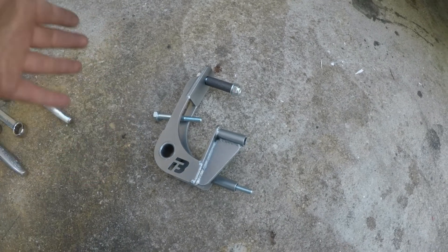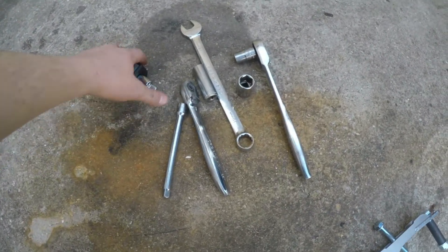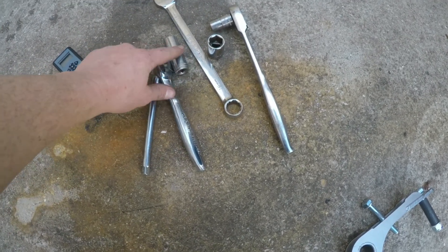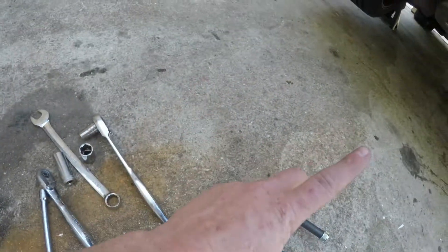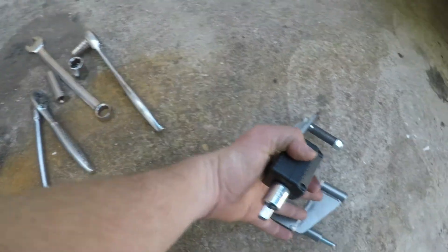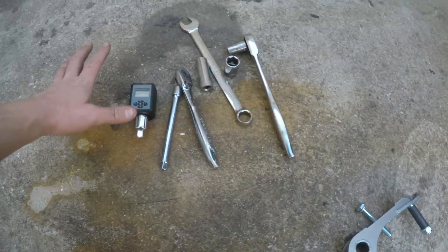So today we're going to go ahead and install this — it's going to be super easy. Everything you need is right here. You need two 19mm sockets, preferably a socket and a wrench, a 17 millimeter, and a 14 millimeter. The 14mm is to pull the cover off, the 17mm to put this on, and the 19mm for this bolt. I also have a torque wrench adapter, because I want to torque down the cover bolts to 32 foot pounds. Let's jump right into it — I promise this will be a quick video.